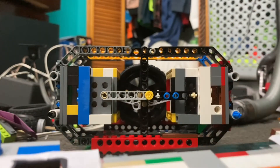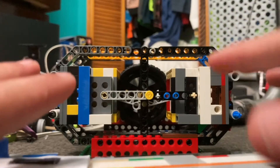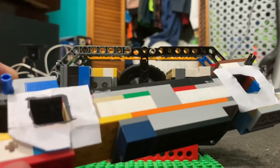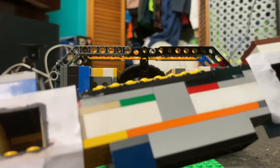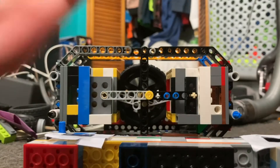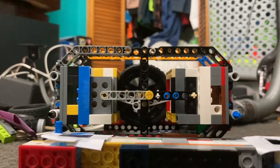Moving on to the intake manifold — as you can see, it splits the air coming in from the vacuum right here into these two parts, which are directly connected to both cylinders via the valve. The paper gaskets on this create a really good seal, and they have worked really well. I'm going to run the engine for you, and hopefully you can appreciate the sound because it sounds amazing — like incredible. I have a plethora of videos, and I will link a playlist in the description if you want to check out my other experimentals with this engine.